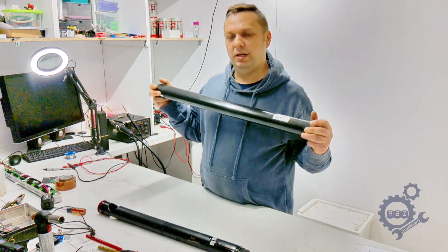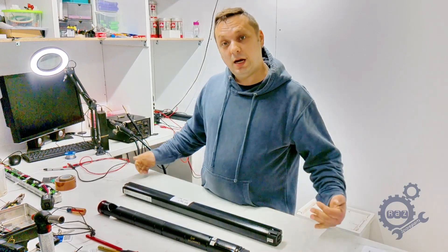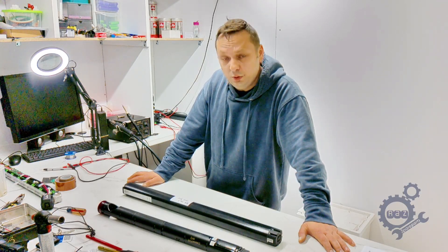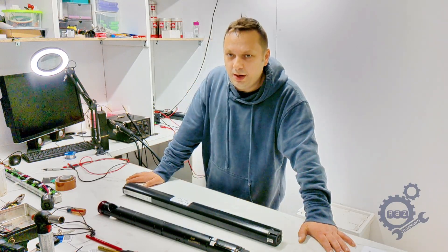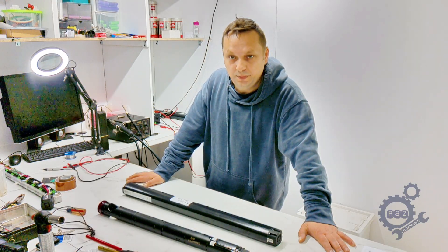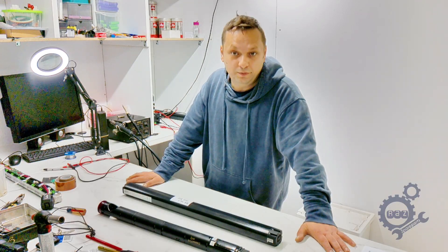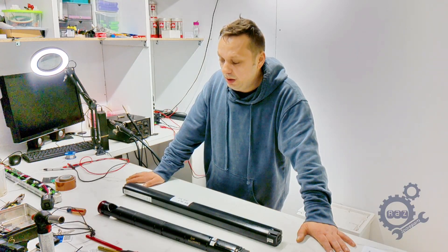This is a battery — some batteries are inside the bike so you don't have much access to them. You need to understand that if you leave your bike in the shed, in the garage, in the cold, in the rain, without recharging or using it, the bike will drain slowly but surely. After two, three, or four weeks when you want to take your bike for a spin, you realize it doesn't work.